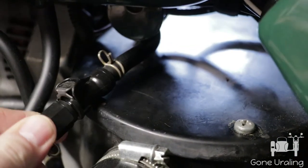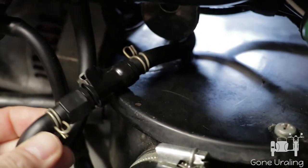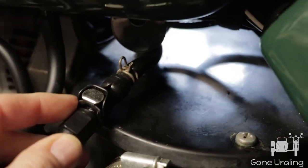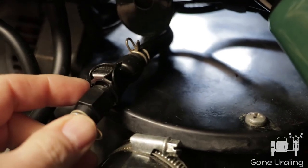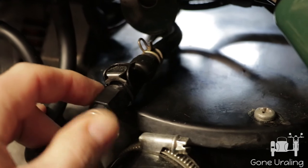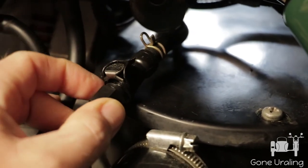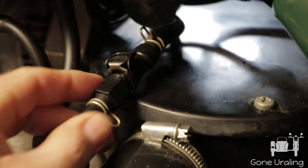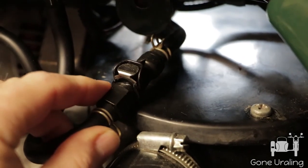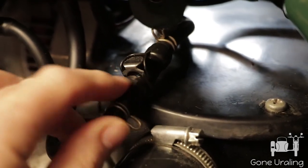Okay, pulling it out so you can see it. It's a click-together design — when you unclip it, both sides stop up; when you plug it back together, it opens. The problem is right around here at the coupling — we're just getting that fuel leakage. You can almost see that it's wet in there.